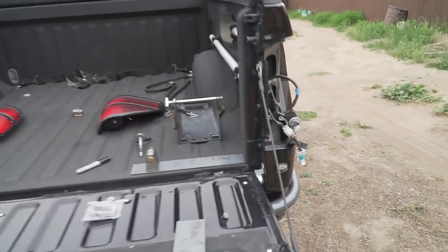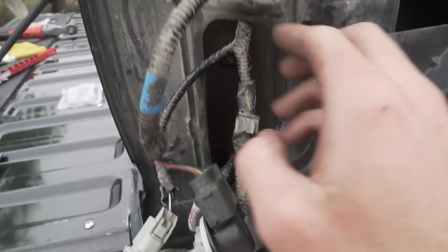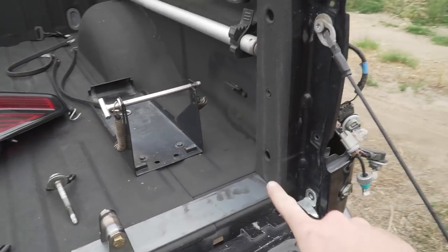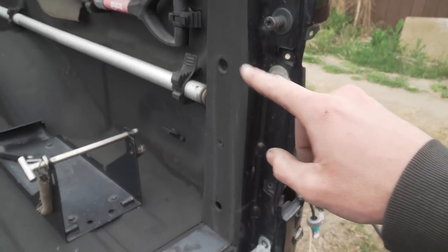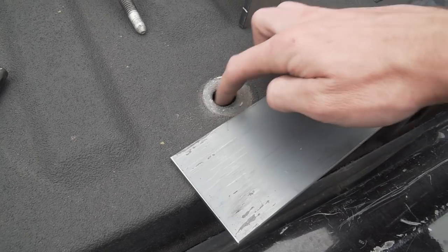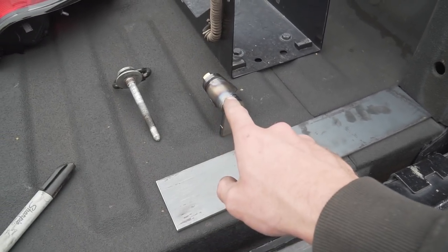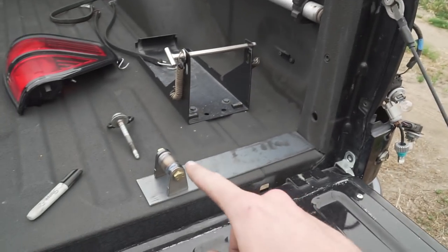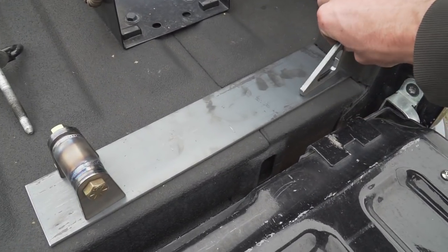Making some progress on this — got both tail lights out, and now you can see on this side right here the bolt hole goes through right there, and then the other one is down there. So we can get to both of those now. As soon as you pull the tail light it makes it really easy to get to those, and I'll be able to mark from the back side with a pen on my plates where the bolt holes actually need to be. I did get these all welded together — these are ready to go. I just need to drill the hole here for the bed bolt to go back through, then I'll tack these tabs and assemblies onto the plate.